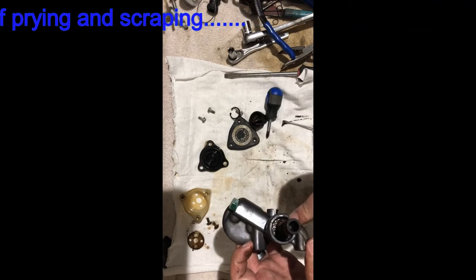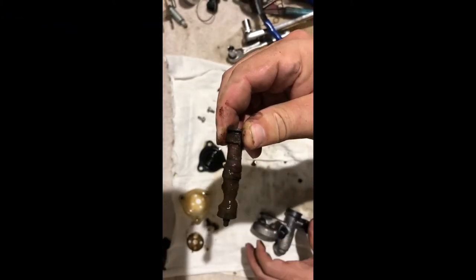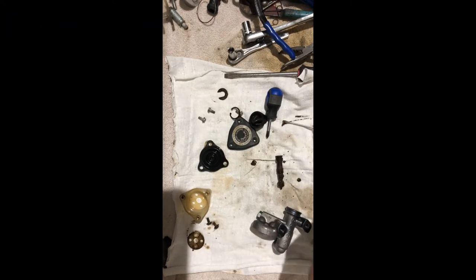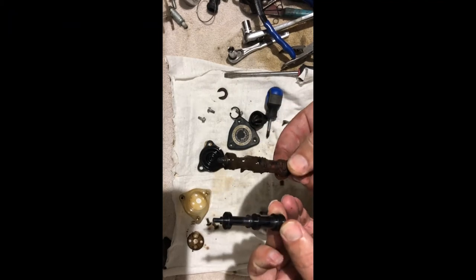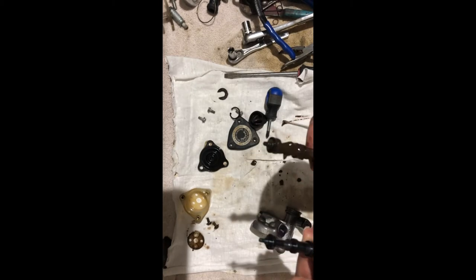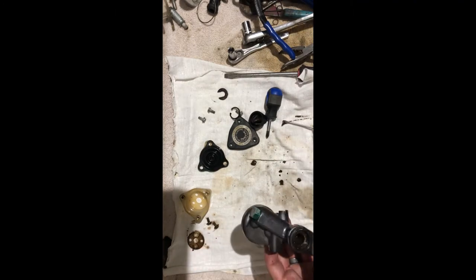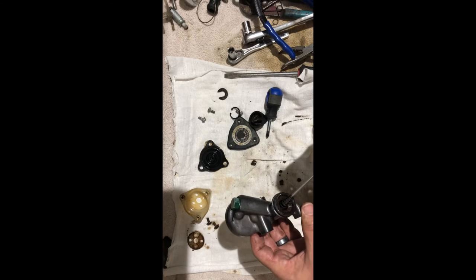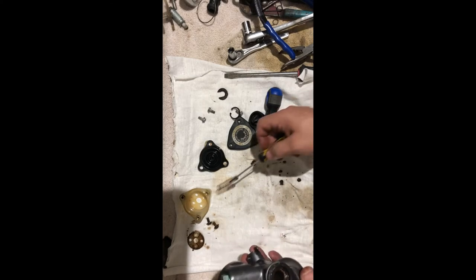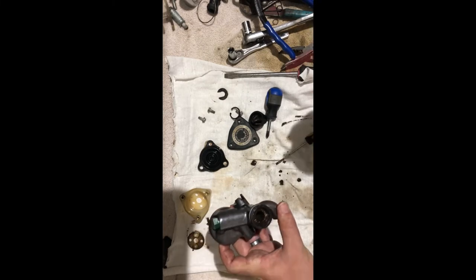This was stuck to the side of the cylinder because it was rusted to it. But now the piston can come out — and this is what this one looked like. Let's grab the new one. Looks like that. As you can see, this one is horrid to say the least. We'll go ahead and set that in our bucket. There's a spring inside of there that you need to fish out. We're just going to start cleaning this out, try to get as much crap out of there as we can.